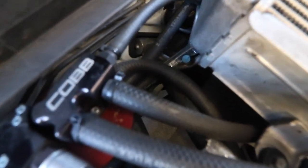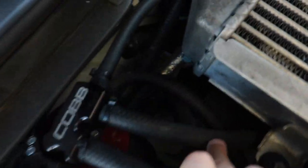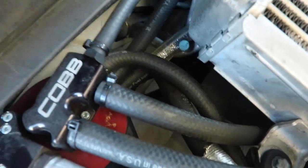For now I'm just going to leave that, but I did notice there's a hose on my AOS that's kind of crimped, so I want to fix that before we get into switching out the radiator. Since I still have the factory top mount, these hoses are all jumbled up, and there's one underneath that's kind of bent. I'm going to relocate that specific hose with the heat shielding over these two so there's not as much weight on it. That got fixed — it now has a lot less bend in it and flows much better into that bottom hole.